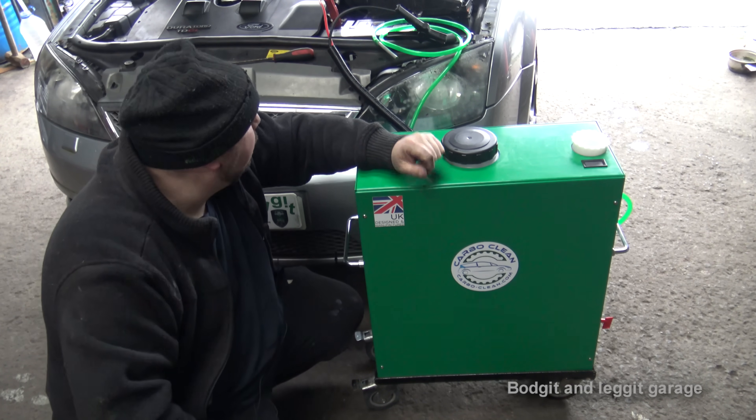All we have to do is put the hose into the air intake. Now if you're thinking about having this as a business, what I would suggest is get some sort of OBD2 reader — doesn't have to be expensive, but you want to check fault codes before you start the job. Some people are going to say you've damaged their car and that problem wasn't there until you used it — we all get that. You might also get an error code from your MAP sensor when you disconnect certain systems.